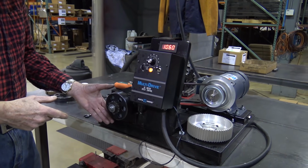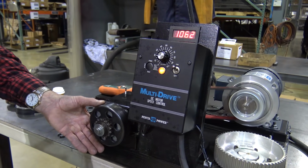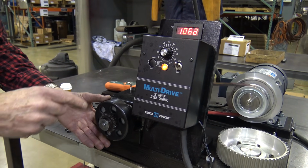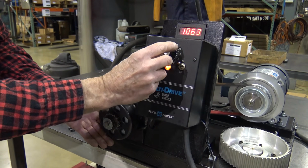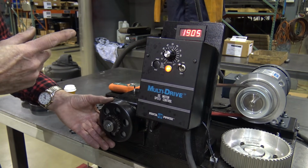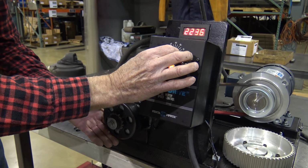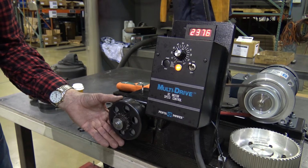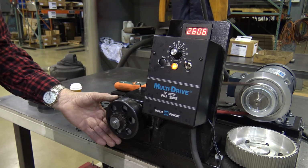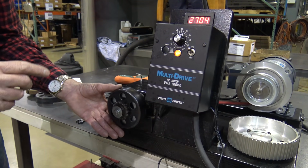I'm at 1,000 RPM, nothing's happening. Even on a gasoline engine, the wheels will start spinning if you take the wheels off the ground. There's no pressure. You will be able to hear the shoes as they start to go out. I'm at 1,900 RPM. It still is not ticking. 2,300 RPM, not ticking. 2,600, not. Now you can hear it. The shoes are ticking against the drum.